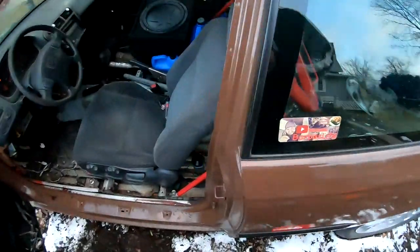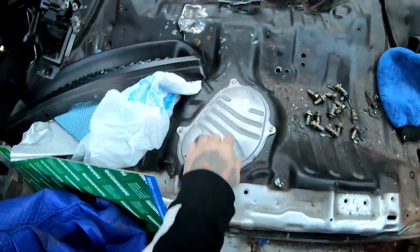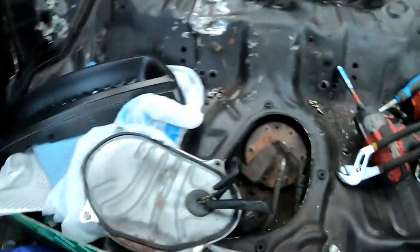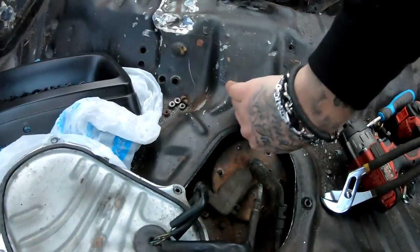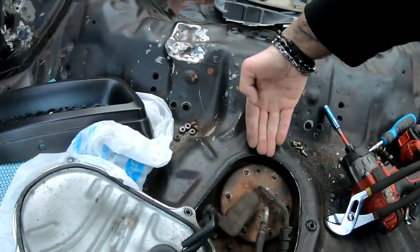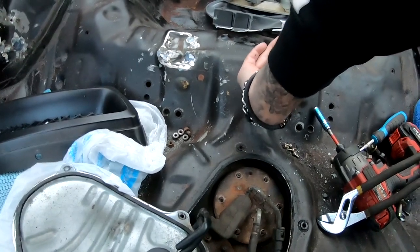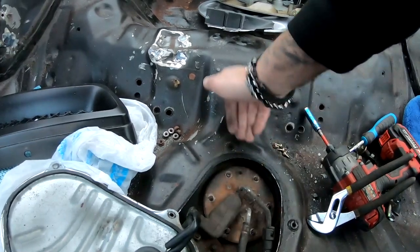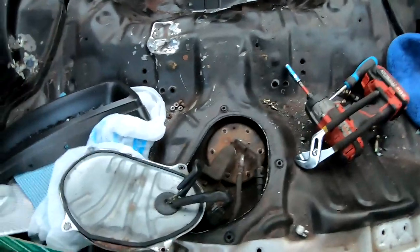I don't know if it might have been something that I did when I was in here last. I'm gonna take these screws off and take a look at the pump real quick. Figured out the problem. I took out the pump, and the filter was, for some reason, pointed up. It wasn't like this, like pointing this way. So when the pump would go in there, the filter was like up in the air. So I went ahead and I spun the pump like this, so then the filter is sitting right where it's supposed to. That's the reason why we weren't getting any fuel.